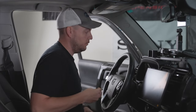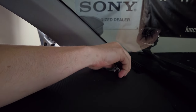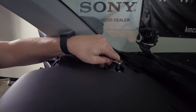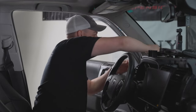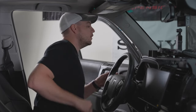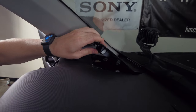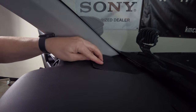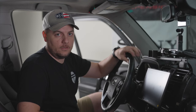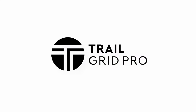Go ahead and put this back into place, then replace the two 10 millimeter bolts. Start both of them with your fingers and just snug them up — they don't have to be super tight. Grab the speaker grill, slide the end in towards the windshield first, then push it down until you hear it snap back into place. We now have our tweeter installed — that was nice and easy! Let's move to the driver door and get these new 6x9s put in.